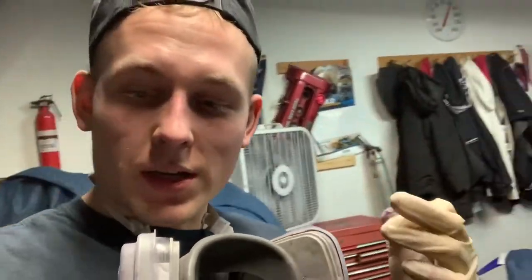It's about 7:30. We've been at this for about an hour and we've got three coats of base on. It is time to spray the midcoat — the pearl, metallic, whatever. It's a tri-stage color. If you guys want to guess the color, throw it down in the comments — the color is going to be revealed in this video. Time to mix up the midcoat and I'm so excited. So far so good, everything's looking pretty good, lying down nice. The base coat looks great, good coverage. Let's slam out three coats of the midcoat and then we get the clear coat.